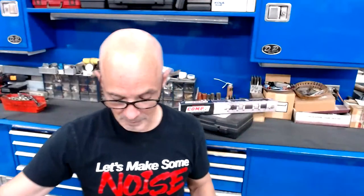I know that if a guy's building a boat motor and I was going to be running it for minutes at a time at wide open throttle, I might put lower compression in it, because I'd be much happier if the motor continued to run. And even if I gave up 50 or even 100 horsepower and the motor lasted year after year after year, I'd be much happier about that.